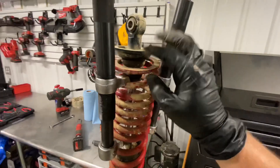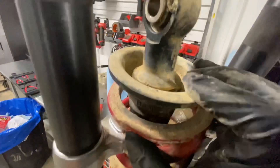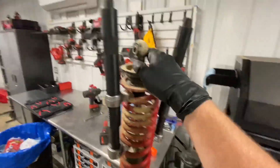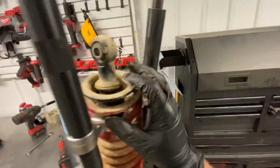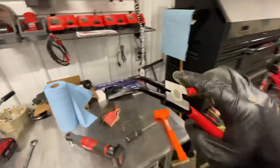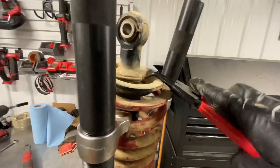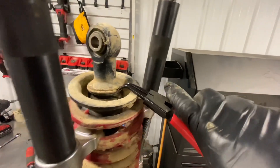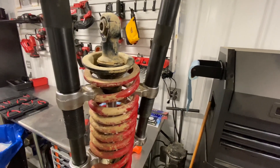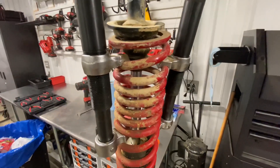What I'm going to do is move the bump stop down so I can drop the spring perch. There is a C-clip in there that you take off with some snap ring pliers. I use some bent nose snap ring pliers — these are Icons, just from Harbor Freight, but they're pretty nice. I put it in there like so and get it — it's pretty easy to take off. Then I'll walk that off and talk you through a couple little things that I personally will do to prep for the new springs.